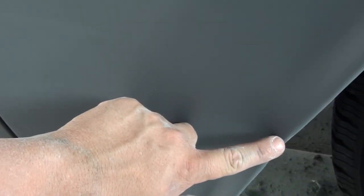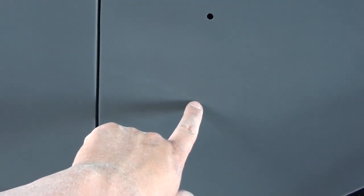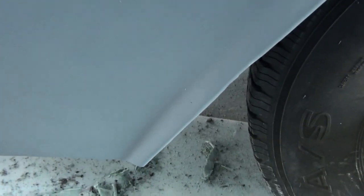I could grind it back, but from the naked eye that's never going to be seen. This truck's not going to be perfect, but I am focused. This fender has been patched before — years ago it was patched more like that, and then patched again by me right through here. It's got a patch from there down that I put in, and needless to say it's overlapped three times. So to get this thing to come out like it needed to, that's what I had to do.